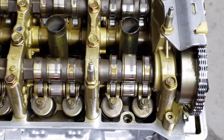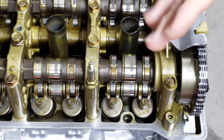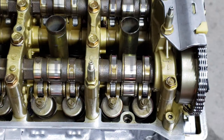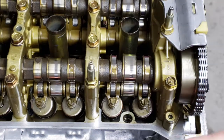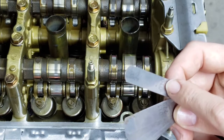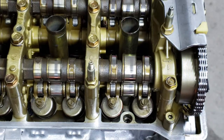On this one, since it's going to be more performance oriented, we're going to set everything on the tight end of the spectrum. The first thing you want to do is get your specs. The whole process is going to be the same regardless of whether it's intake or exhaust, but they'll generally have a different spec. This is the exhaust side. The spec on the exhaust side is going to be within 0.25mm to 0.27mm, or 0.010 to 0.011 inches. Make sure you've got corresponding gauges, whether standard or metric.